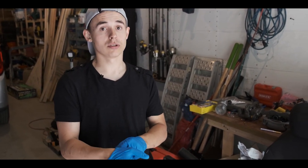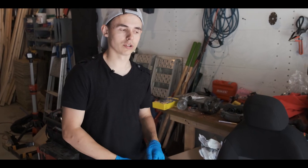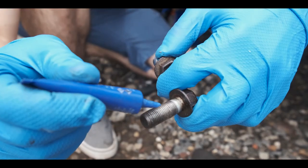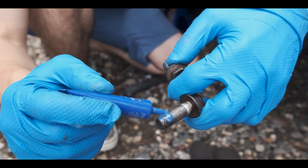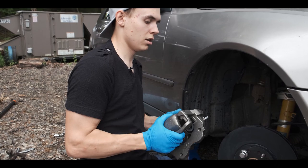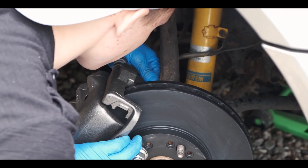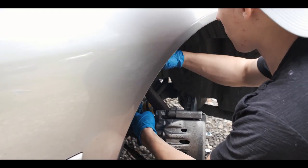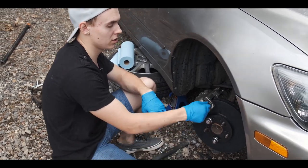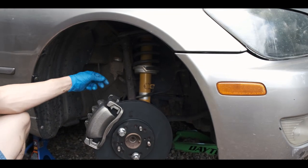It's gonna get a little dirty because we also have to bleed the brakes to get the air out of them and get nice fluid in there, brake fluid. That's all you need. Same thing on the other one. That's it. Right, now we're just gonna redo our steps. We're gonna plop it back in, and then we're gonna undo these bolts after we bolt it on. Now we just gotta tighten it down. Just nice and snug. So we just finished tightening up the bracket to the frame of this knuckle. Now we're just gonna unscrew one of them.